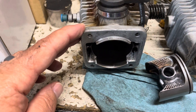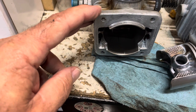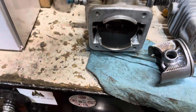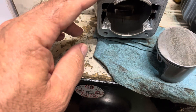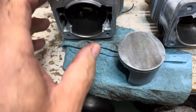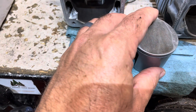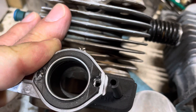I have two cylinders I'm looking at. This one I did some work to the top of the piston for blowdown corrections. You can see the piston design is a little different from this original style — both 7900s but different piston styles. This one timed out at 25 thousandths squish with no base gasket. I had a ring end gap of 22 thousandths — about half that would have been nicer — but it actually made decent compression. Exhaust was at 103, transfers opening at 126 by modifying the piston, and intake at 80.